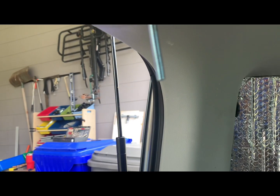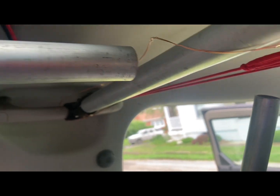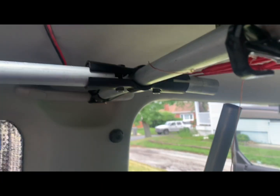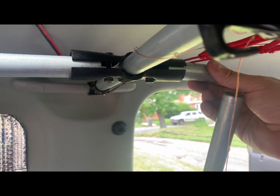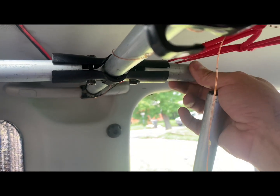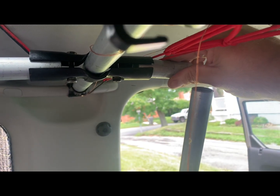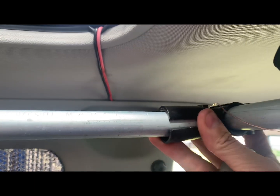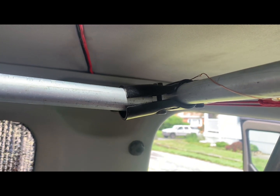I hang the hook up inside, get the thread coming down, and then insert this. Now that it's tightened up, we pull it up and use a 180-degree connector to put it on there, then add a three-inch extension off the other side. One of the great things about working with Maker Pipe, especially in non-square situations, is the measurements aren't always exact. If you need an extra quarter inch you can slide it out, even up to a half inch. Also, once bolted down, you can still slide it around — not like wood where you have to back the screw out, move it, and end up with Swiss cheese wood every time.